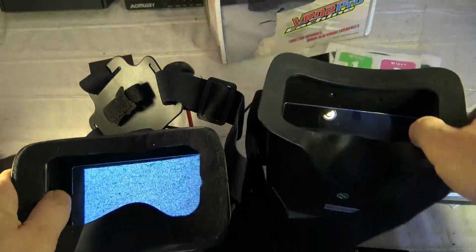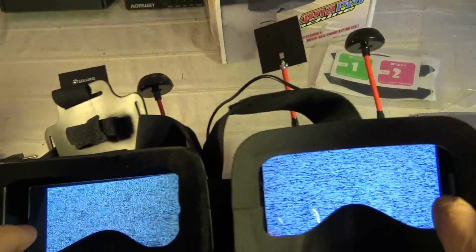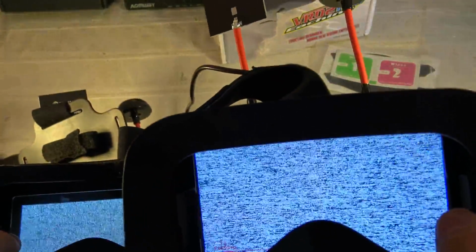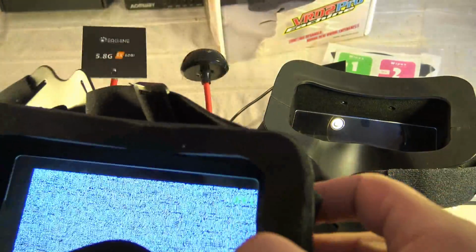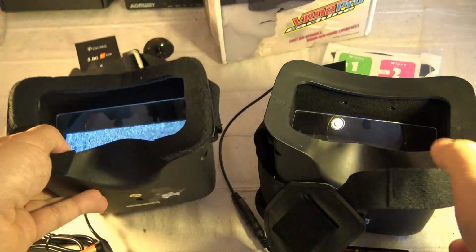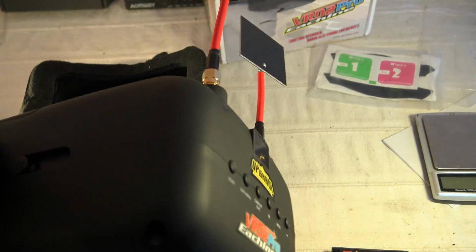I will magnify with the same amount. Look at that, we can see that here the magnification of the Fresnel lens is more important. Maybe you can see that the pixels seem bigger compared to this one. So they probably changed the Fresnel lens with a higher magnifying factor in the new version. So a little bit better news for myopic guys like me.